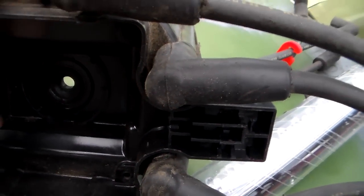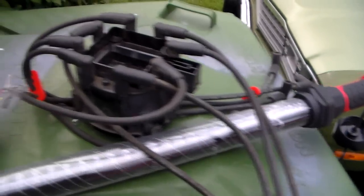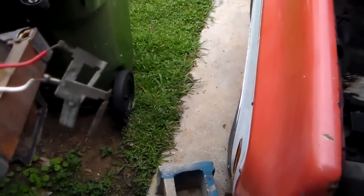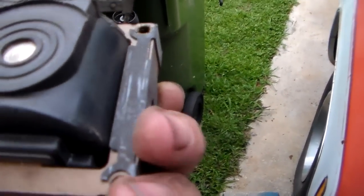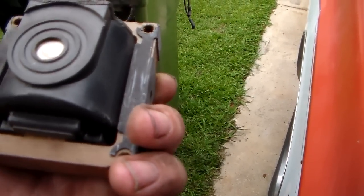I'm not sure what to make of that. I don't know if I need to go ahead and buy another coil — I don't want to buy another coil, this one looks new. There was another one sitting in the floor in here, and they both measure out fine on ohms, so they seem to be okay. But this other one hasn't been doing that — no evidence on the bottom of this other coil of that happening — so I might just for now go ahead and put it back together with that one.